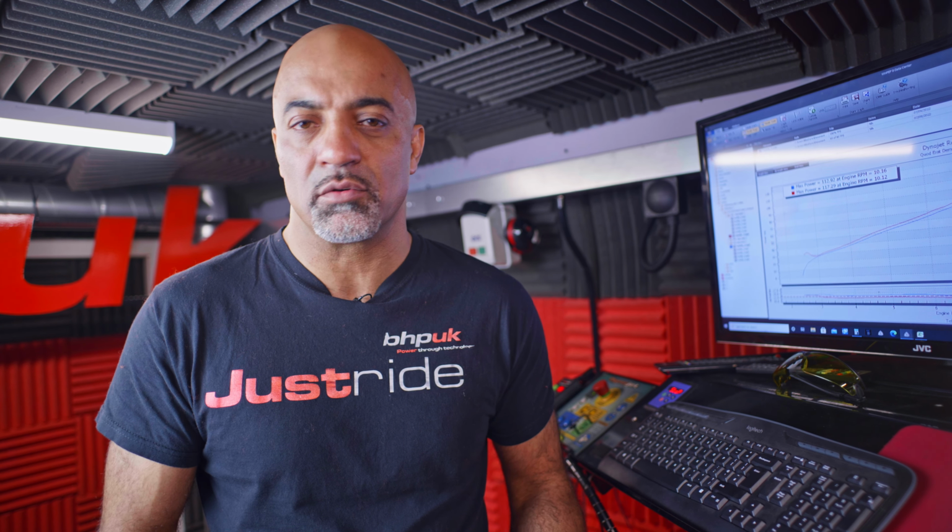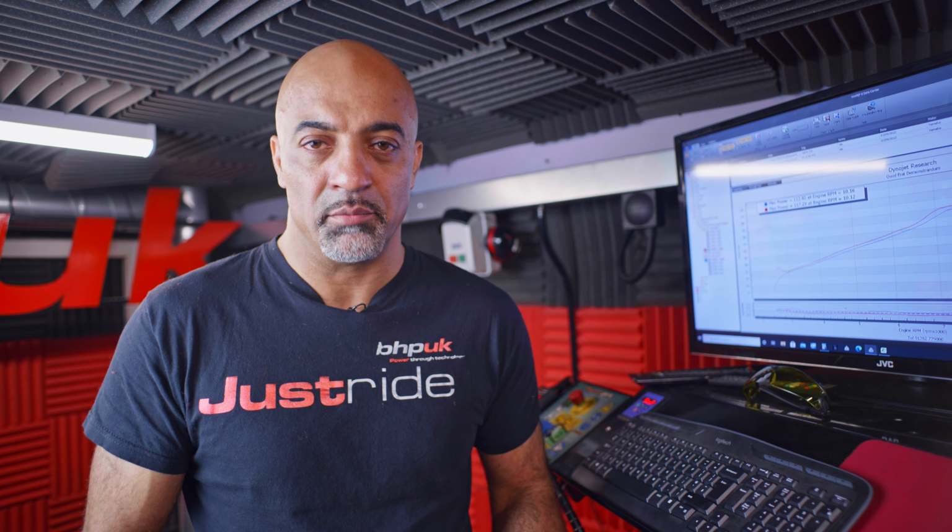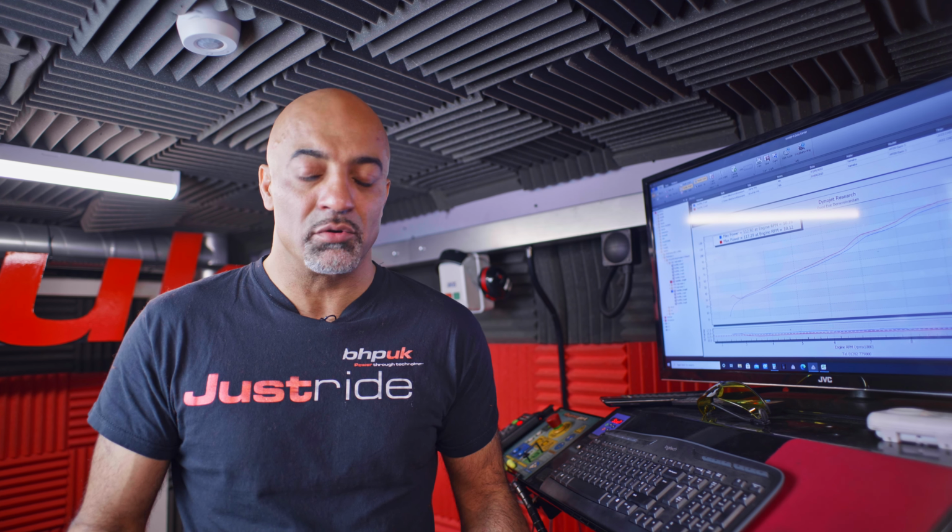If the bike is used for mostly track days or racing, we can alter the amount of time that the ECU cuts the spark between gear shifts. And we can obviously remove the speed limiter. The speed limiter on this bike was set to 133 miles per hour. If you've got the courage to exceed that, or you've got the wish to exceed that, or it's on a closed road, then we can remove that limiter altogether from the bike.